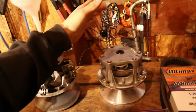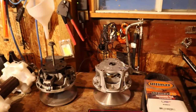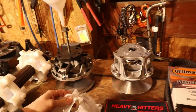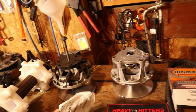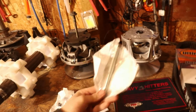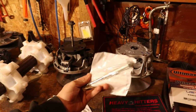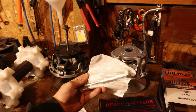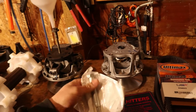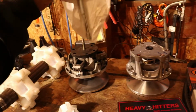It's a really light clutch. They've been around for a long time. Is it old technology? Yes. Does it work really good? Yes. So with that, we need to run this XM bolt, from a Skidoo XM, so what is that, 2014 to 2016, that style of sled. That's the clutch bolt. It is longer than our factory one, that's why we need it.